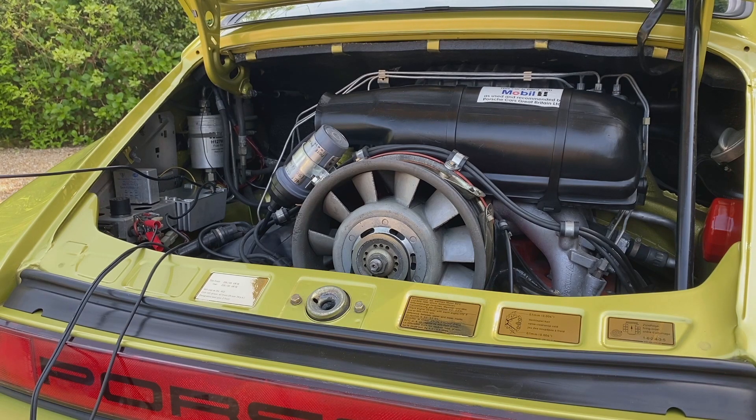Remember we've got the graph at zero up until 2000 RPM and then at 20, and we want to set the timing so that it reads five degrees at idle and 25 degrees beyond 2000 RPM. In all honesty, the best thing to do is set it up at the high end where it's more critical — I'll be bringing the engine up to 2000-plus RPM and adjusting the distributor until the timing light reads 25. Let's give that a go.